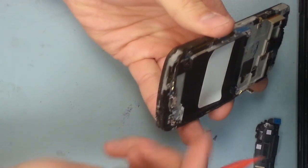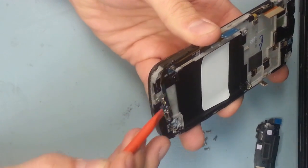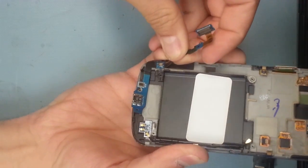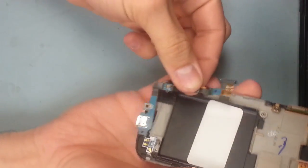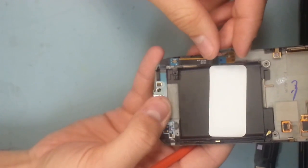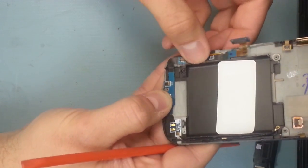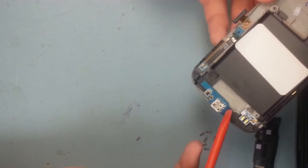I'm going to show you how to remove the charging port, because that's usually one of the main things that go out in cell phones. There is sticky tape holding it down into place, and each one of those little segments has a guiding hole that helps it fit onto the screen. I'll put it back into place making sure it hits each of those guiding holes. I'll try to post a link in the comments of where you can buy these just in case yours goes out.